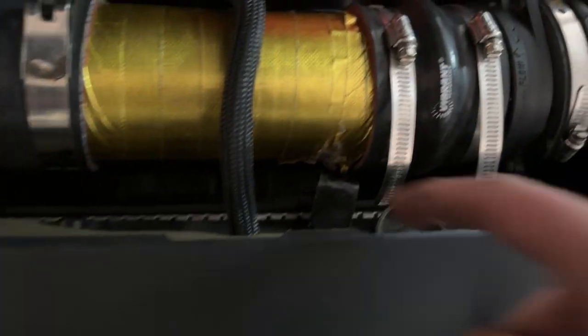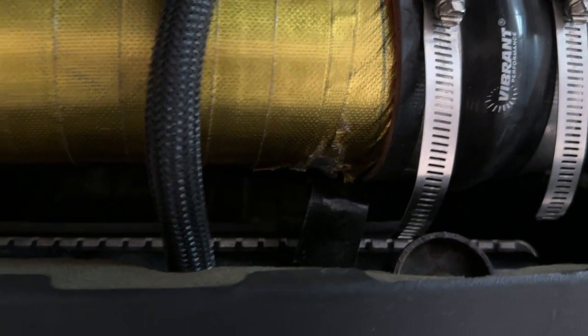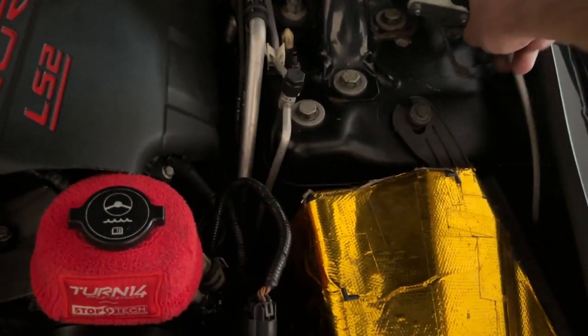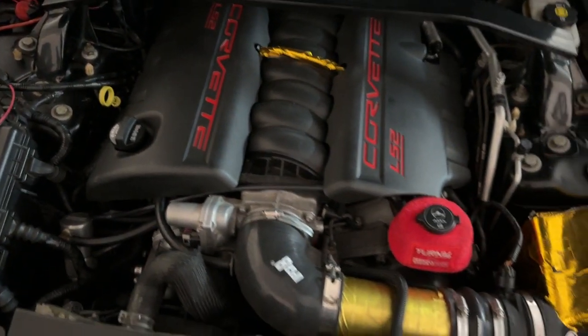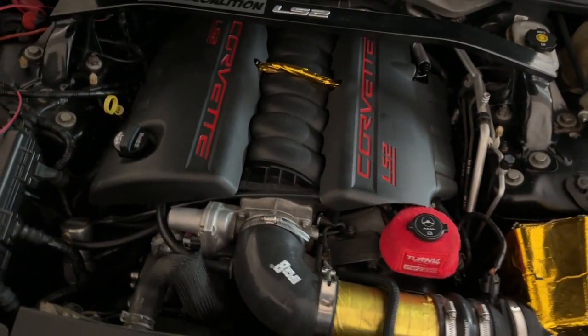So remember I was talking about room between the radiator - you can't even fit a finger down in there between the tube and the bolt. I have a little piece of tape on it from test fitting a carbon fiber one. We've got our clutch quick connect bleeder tucked back in there, the hose back on, oil cap back on, intake back on. We are looking good.